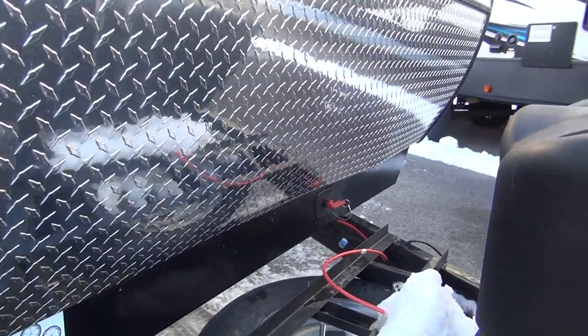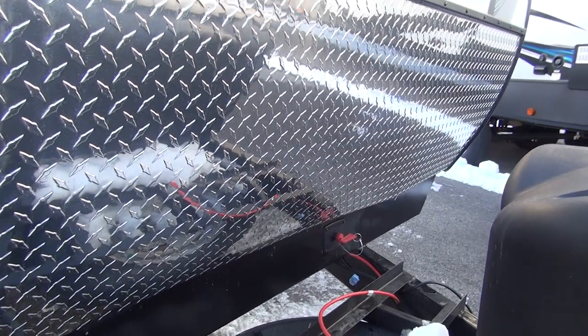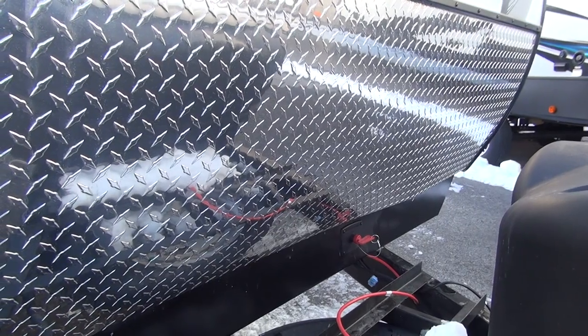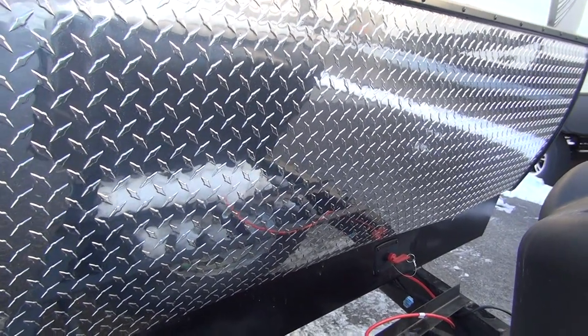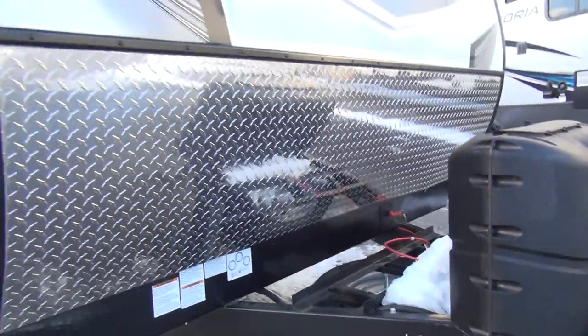Right up on the tongue, you'll see that little red key — that is a battery disconnect switch. It simply turns the batteries off so we don't have a parasitic draw from our stereo face and our LP gas detector. So when you're in storage, you can turn those off and you don't come back to dead batteries. It's a really nice feature that comes factory standard from Coachman.